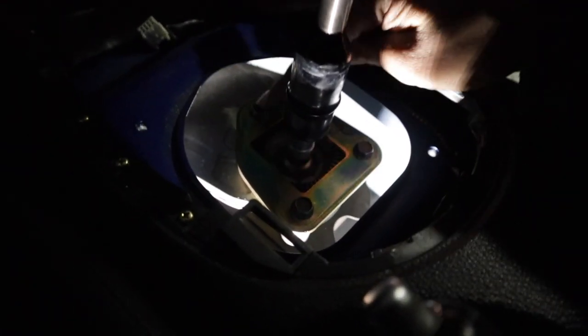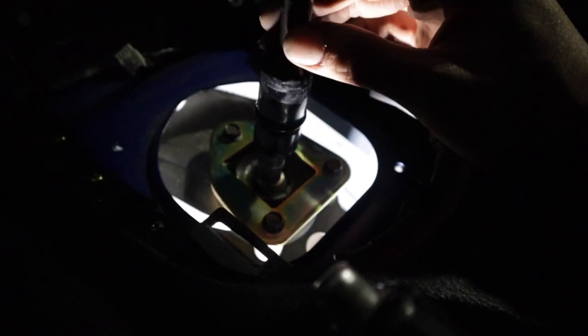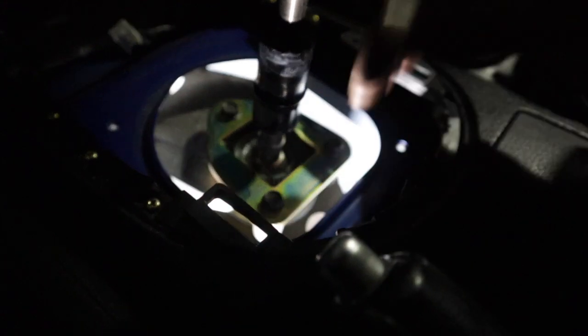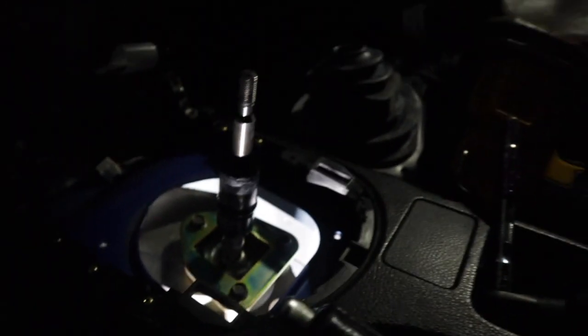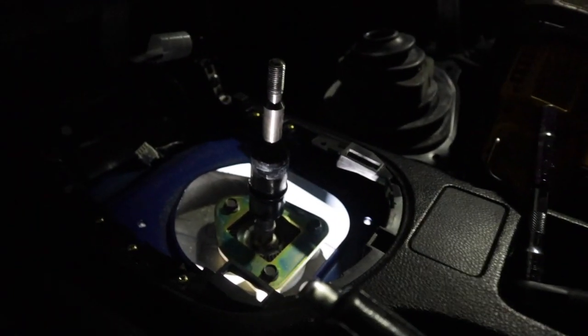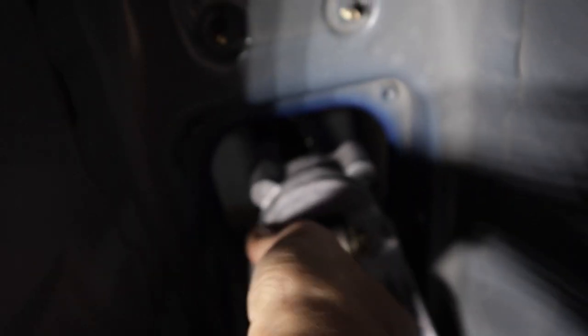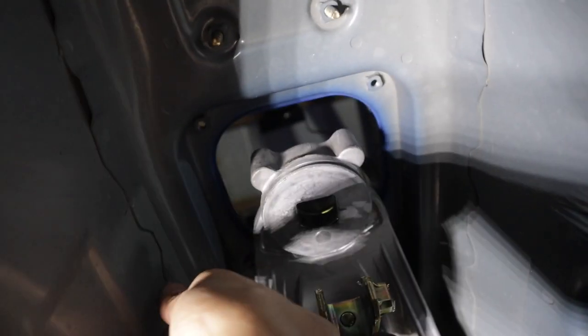I forgot to take off the three bolts from the top to remove the shifter — that way I can slide the transmission back easier without hitting the frame. You got this rubber boot on top, slide it right out, and then there are three 10-millimeter bolts holding it in. Take those off and slide it right out. To take that off, remove the rubber boot on the bottom, take out the 12-millimeter bolt, and it slides right out.